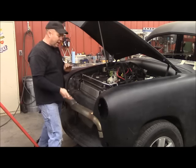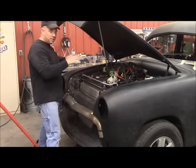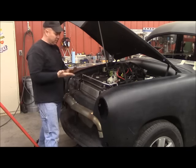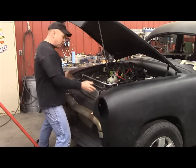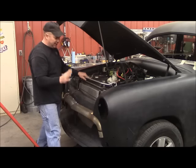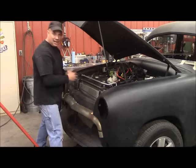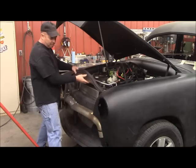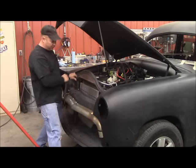It is exactly the right relationship to the body within a millimeter, so I was very pleased to have that in place. When I made your bushing mounts I added a shim underneath them - that way I can go down as well as going up. Right now it's dead on the money, but you never know once we take this apart and put it back together if we might need that movement to go down. So I always add a shim under all my mounts or bushings. Then I'm going to come in here and put your tie bar - you can see how close this radiator is in the exact location, and it's in the exact location for the Explorer and for the Woody, which is just amazing how well it fits.